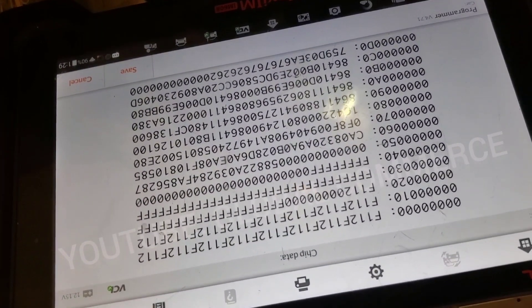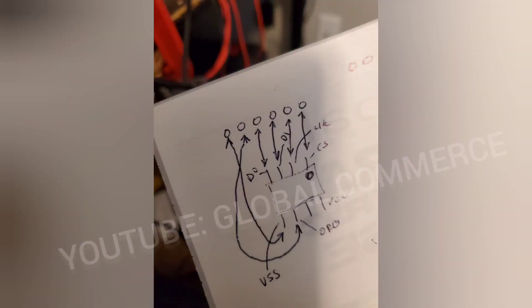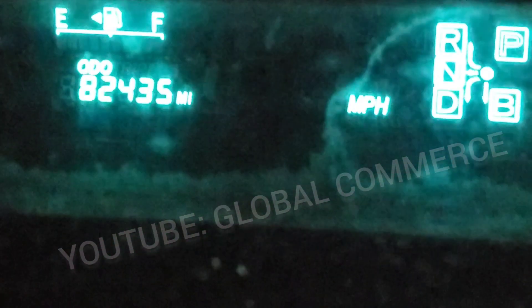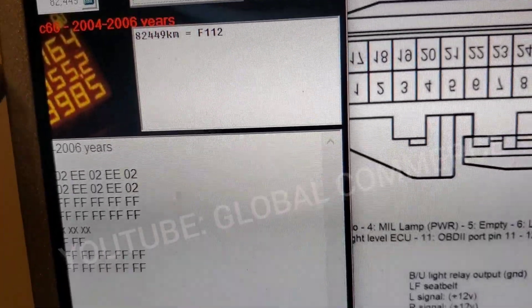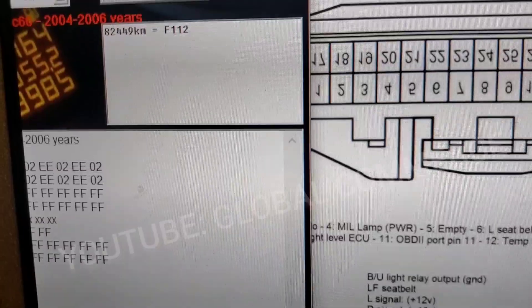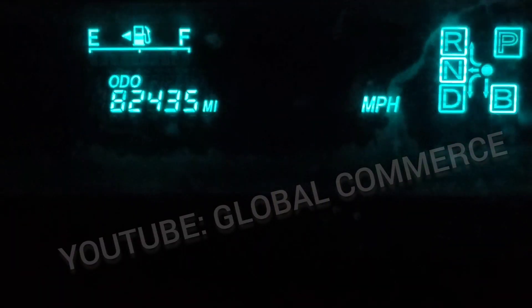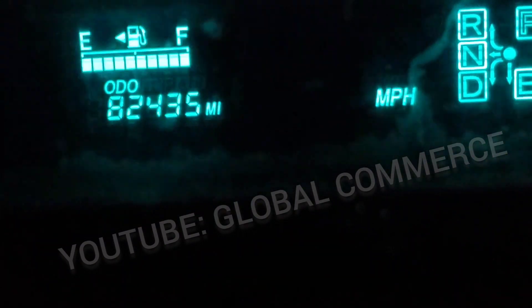Here's the pin out of the cluster — I connected it up with two power lines and a ground. By the way, you could skip the step of moving to the laptop if you have a hex editor; you can edit it right on the IM608 as well. Now powering up the cluster — and there it is. The mileage is showing 82. What happened is: even though the app said kilometers, it was actually reading in miles, so that's a bug in the app — I'd have to go back and fix that. But that's the process. Now you know it. Hit that thumbs up and subscribe — see you on the next one.